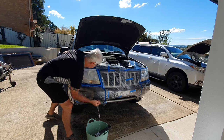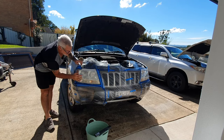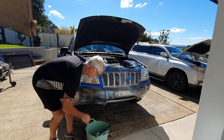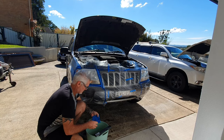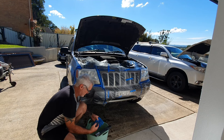Get this front edge here, then give it a bit of a rinse off. It's not like painting a car — it doesn't have to be dust-free. So that's the 400 done. Now we're going to step it up to 800.